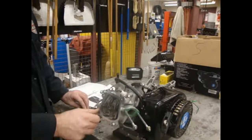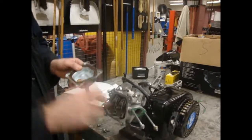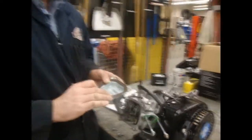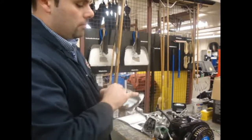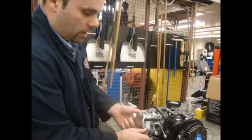We're going to remove the four bolts. Make sure the gasket is in the proper place — not torn or damaged. This gasket is still in good shape. I wouldn't reuse this gasket if this was an automotive engine for long-term use; there is slight damage in one corner. But for these engines it will suffice because they're not going to be driven or run for long.